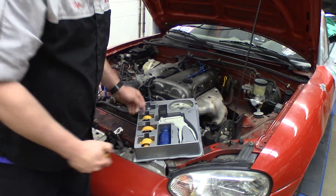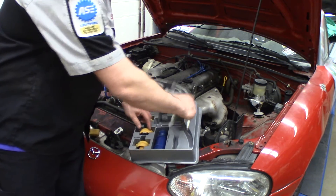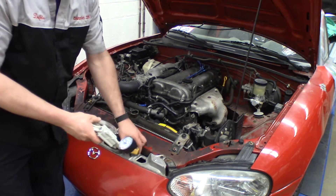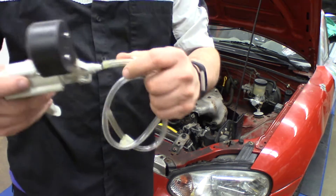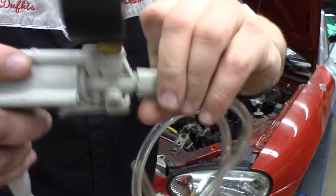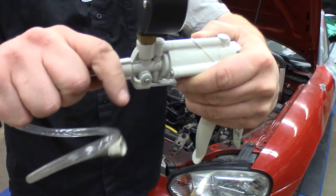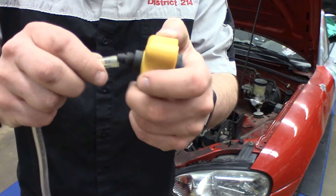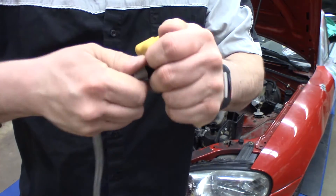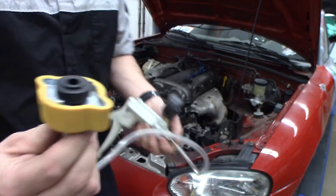Also included in this kit are two radiator cap testers. If you're testing the radiator cap pressure — which we'll do in a little bit — we have our vacuum pump and our hose. We're going to grab our vacuum pump, hose, and bayonet and set this up. Take the hose and put it on the end of the vacuum pump; the line just pushes right on. Take the nut and screw it on — make sure it's nice and tight, because loose connections will cause a pressure leak and bad readings. Give it a quick pull to confirm it's secure, then do the same on the cap side: push the hose on, tighten the nut. A good trick is to put your palm on the center of the cap and really twist it down.